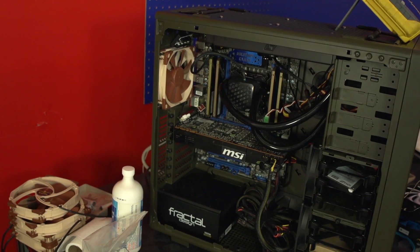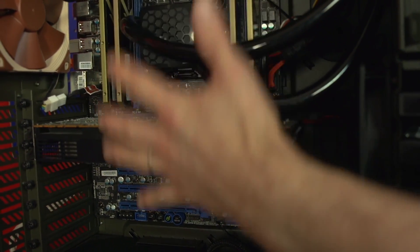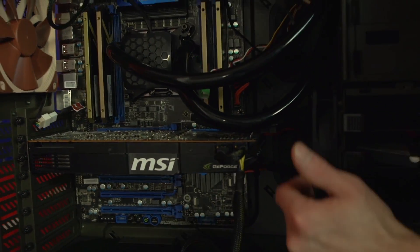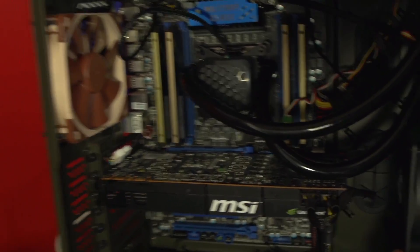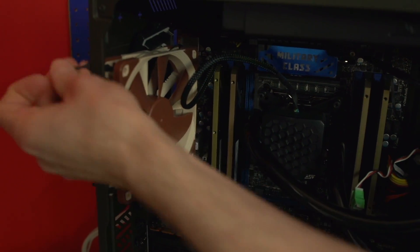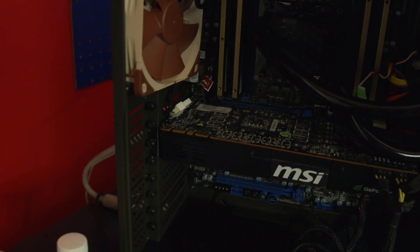We use a real system inside with a GTX 580 that runs Furmark during our load test, so that we create heat inside the system — more like a real system would be if you're actually playing a game. We have two fans here that run at 7 volts, and a fan at the back that runs at 1100 RPM, held on with rubber washers. 16 gigs of RAM. We mount our coolers in the top or the back depending on what kind they are. You can see we've got a Swiftech PWM splitter over here, making sure we're running everything properly. 1000-watt power supply, 32-gig SSD.